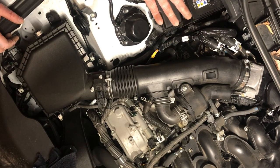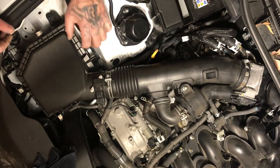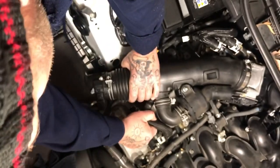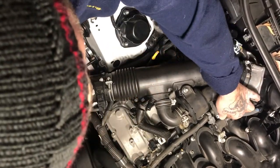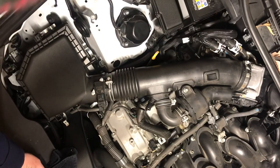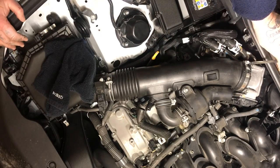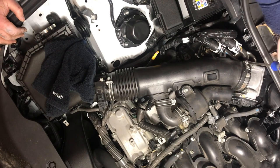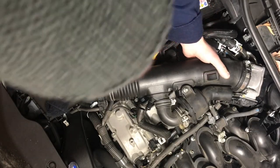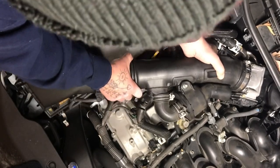This is one of the easier cars to do this with. Pop your airbox off, pull the prongs, pull that little wire clip off, pull the hose off, then unscrew this hose clamp. You want to get a throttle body cleaner — or carburetor cleaner, but probably throttle body cleaner.